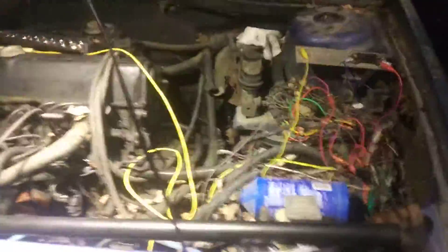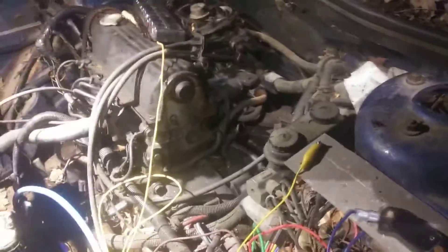And then down here, I think the way this comes apart — I've got my alternator sitting on it right now — is that you take the nut off of this hickamajig down here. See that bare stud there. That's how I wipe that bolt out of there and that transmission mount flops out of there. This here is another transmission mount. That nut's got to come off and I guess this bolt's got to come out of here somehow while you're holding the thing up, because it's going to fall out onto the ground. So that's allegedly how it comes apart.